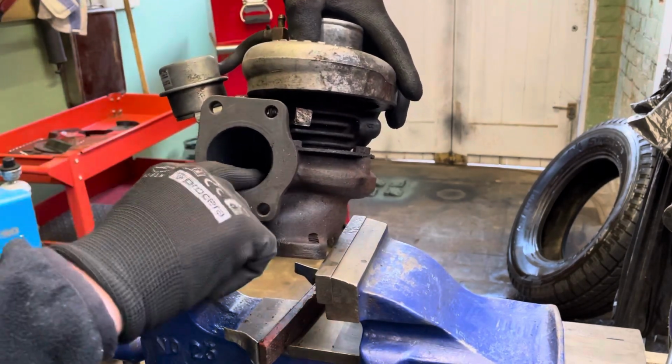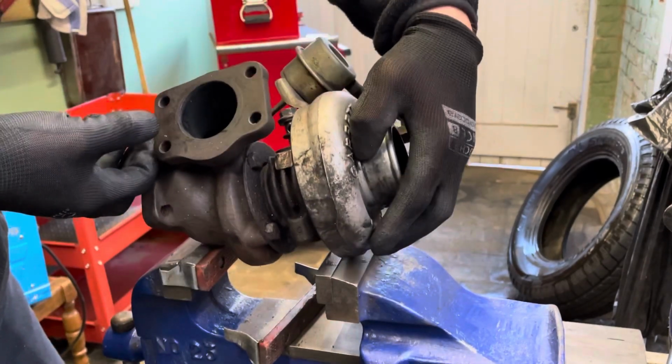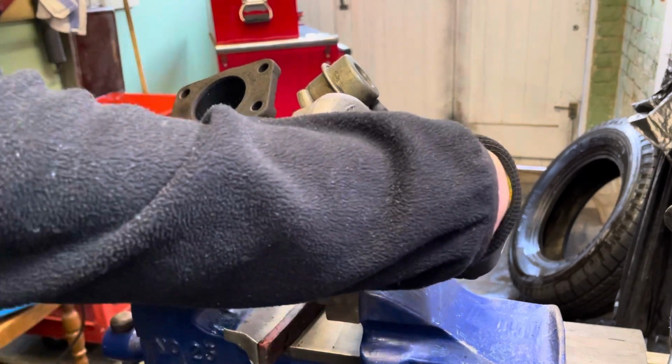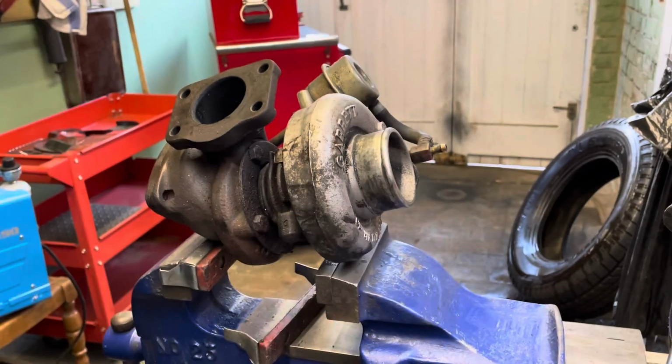It doesn't look like it's burning oil in there. So again, when we're doing our investigation, we are burning some oil in the engine, so we're now presuming it's rings rather than the turbo seal that's gone. Although the bearings have gone anyway in the turbo, so we've got to rebuild it. But it's likely the rings on the engine. So there's our turbo work. We're going to have to rebuild it. I'll talk you through the rebuild when I've got it in bits, and we'll see where we go from there. My name's Mark. Thanks for watching.